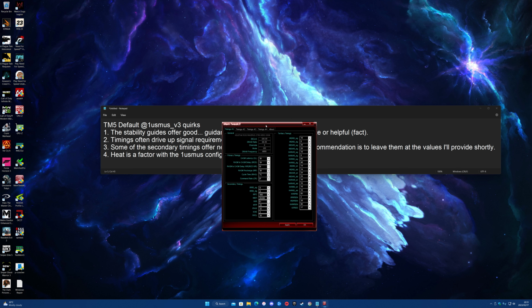And in that video, I can't exactly remember how it works, but from that video I watched last year, 10 gigahertz NetBurst explains it very well. The way he explains the timing, you kind of get an idea of why lower tRAS is not always conducive to performance. And you can see it too in testing. It's not going to make you gain a bunch of points having tRAS down the floor.